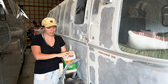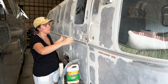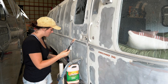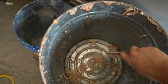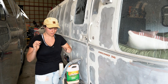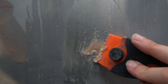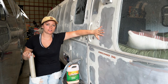Once I've painted it on, the back of the product says you can let it sit for five minutes and then start to scrape. Normally I'll take a huge section, paint it on, and once about five minutes is up I'll take my plastic scraper and scrape, carrying around a little metal bucket so all the yuckiness goes in there. The scraper also has a little plastic blade on the other side so you can really get in those rivets if needed.